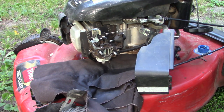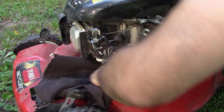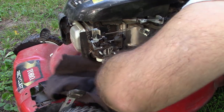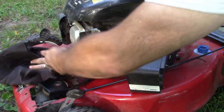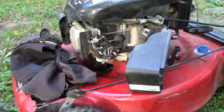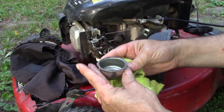I don't, because of that spot on the bottom here of the, on the deck that was already wet. And then touching my finger to the bottom of the carburetor bowl verified that it was in fact leaking.